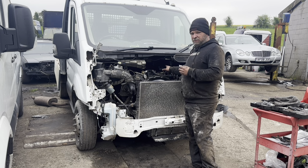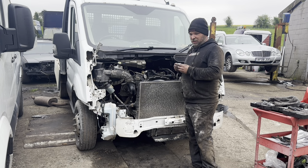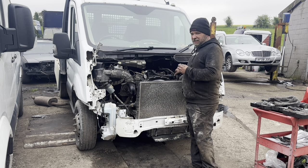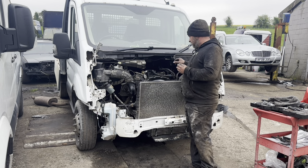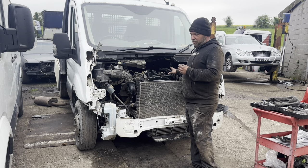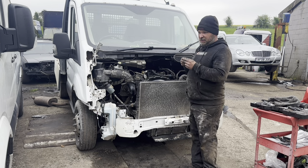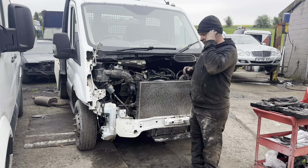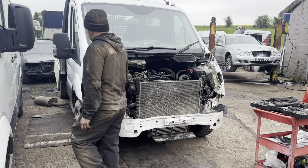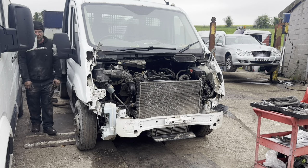Should have fuel. I pulled the rail pressure sensor so that it doesn't start, because what I want to do is crank it and basically get some oil prime, so get some oil around everything. We cranked it with the oil filter off camera, got the last of the gunge out of the system that we didn't like. Clean oil through. So hopefully it might work. Oh, I'm going to need a key, am I?